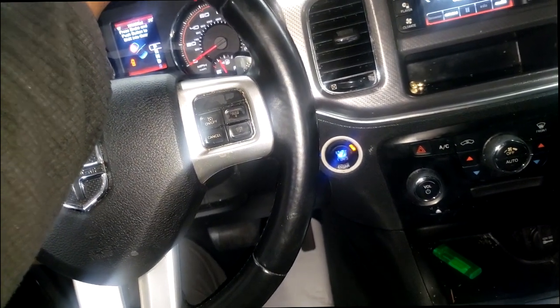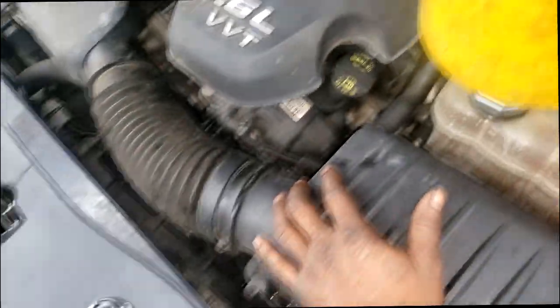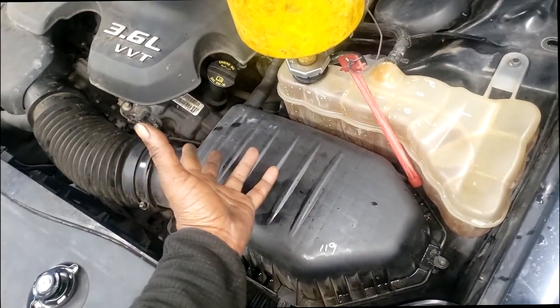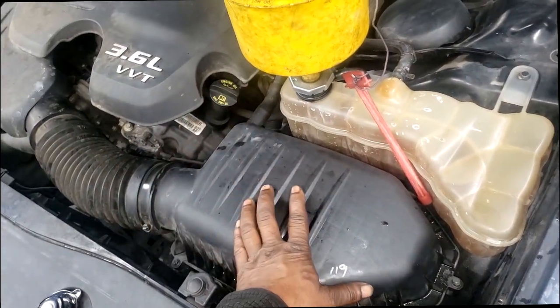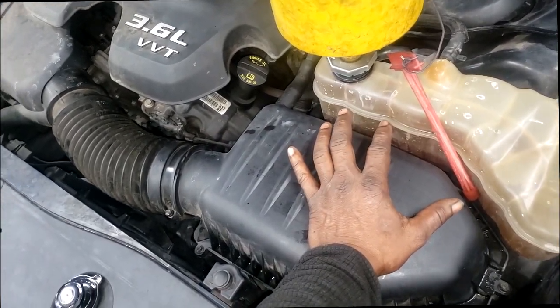And the extra mile is simply, like I said before, I use my bleeder funnel. And I'm going to tell you another step that I do. I go and do a major test drive, guys. You want that coolant to circulate throughout the cooling system. There's no reason I should have used a whole gallon of antifreeze if there's no leak. That just tells me that it wasn't full at all.